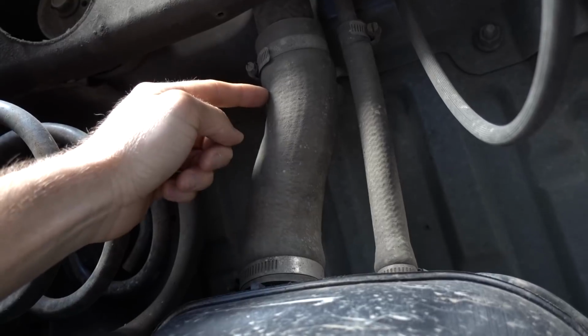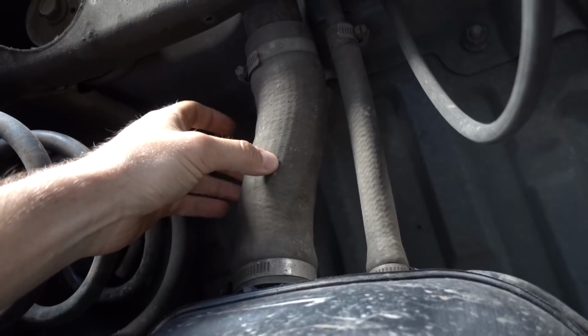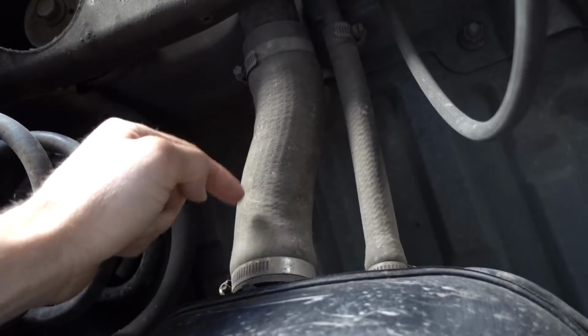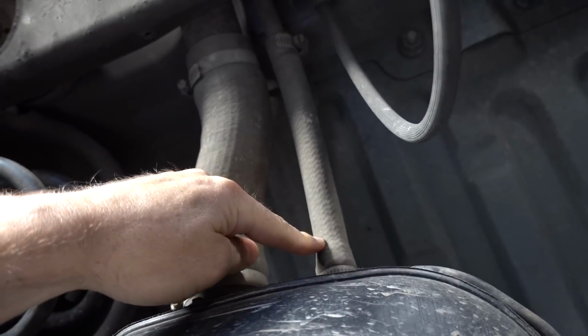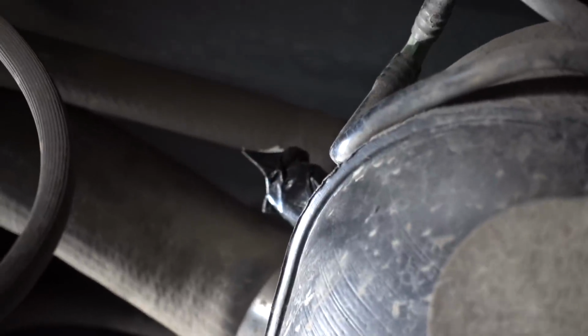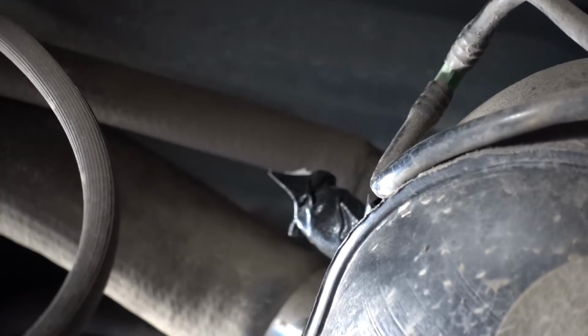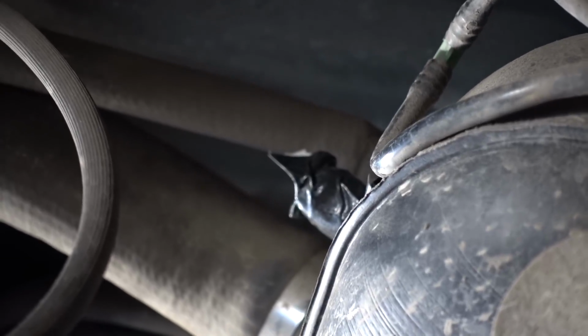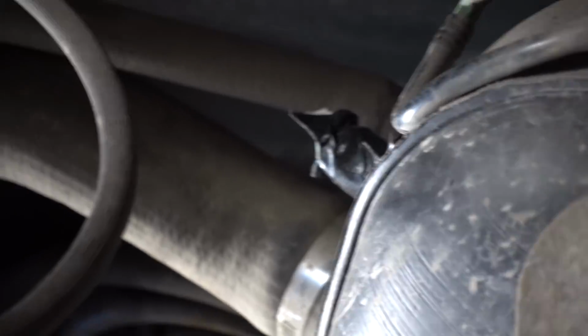And so what you're looking at right here is the rear of the tank, and this is the fill tube. And what I'm gonna have to do is take this tube off. I'm gonna try to take it off of the tank side. I'm also gonna take the smaller tube here off. I already got the small tube off of there. I just wanted to show you. I wrapped it up in duct tape because I just didn't want the fumes flying around here while I'm under here working. So as soon as I put that duct tape on, the fumes went away. So that's a good thing.